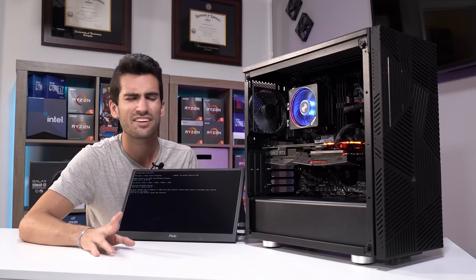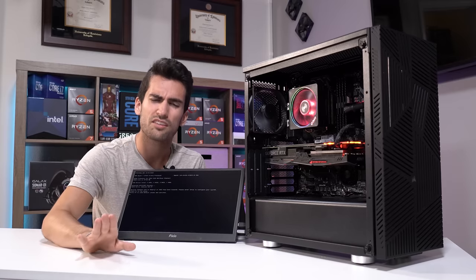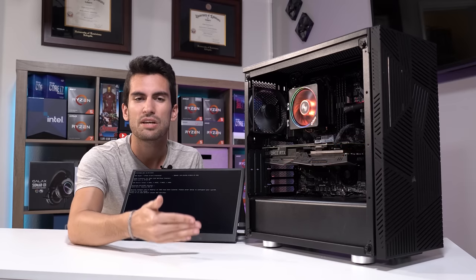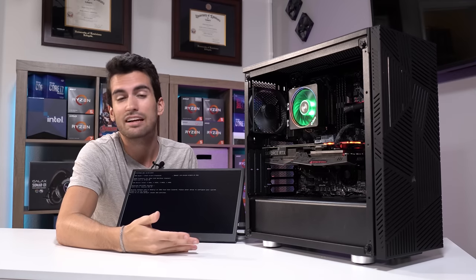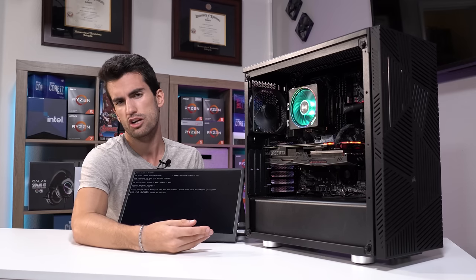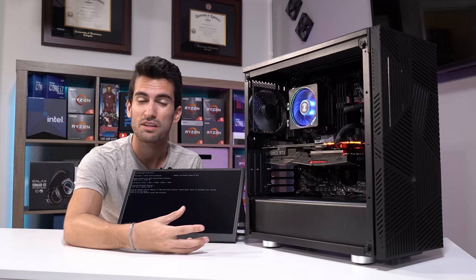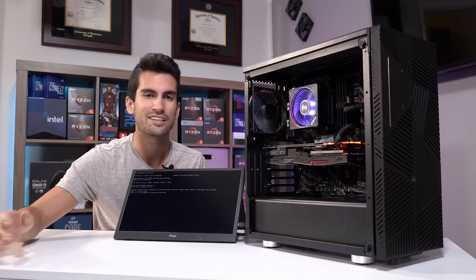I get some hate in the comments section every now and then — just a few people who complain about my troubleshooting process. 'Why are you bothering to clear the CMOS? You should have jumped straight to the power supply. You should have known that was a power supply issue.' Relax, my friends. I just run through this as a quick little checklist because it takes literally seconds. You're trading seconds for peace of mind because you never know — it might come down to just something as simple as clearing the CMOS. I've seen it happen so many times. Sometimes the build will just flicker on and off and you'll think that's probably a power supply issue. But clearing the CMOS and checking RAM take seconds to do, and you want to rule out those simple fixes first, because you're really going to shoot yourself in the foot if you run through a bunch of hardware swaps only to find out that clearing the CMOS was all you needed.